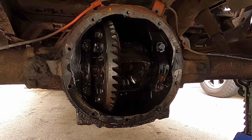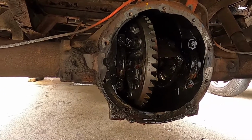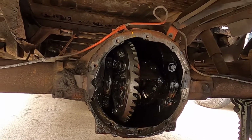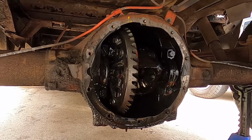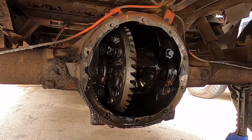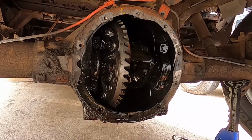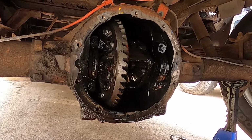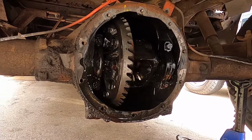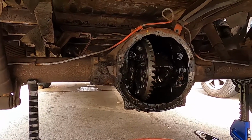We go on the highway. If we put a 373 in here, we could probably almost pick up a full second in the quarter mile. As it sits right now, I'm only using first and second gear. I'm at the top of second gear when I'm going through the traps, so maybe on down the road we can find a 373 to toss in this and definitely pick up some time. Until then, we'll just continue with the mini spool.